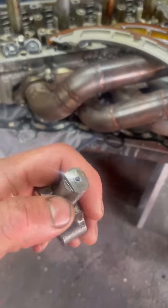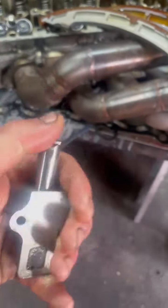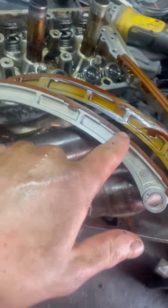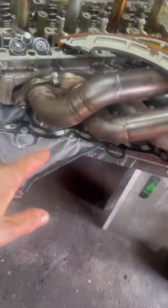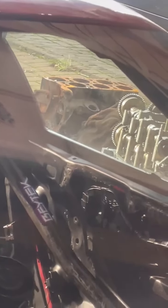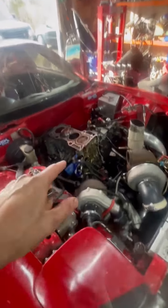So damage report is this piece here - my tensioner. As you can see, the chain's actually been running on the side of the tensioner, just here. You can see it been wearing away. So the chain itself - I'll obviously stick another chain on it, but the chain doesn't look too bad. You can see what's been wearing on the tips there. We'll stick another one on. It's also run off the side of the tensioner. I have no idea how long this has been doing this for - this could have been on the dyno, it could have been any time. But this is what it's supposed to look like, and that's what's worn down. And the head gasket. So we're pretty good to go, guys. I'm happy with that. It's not time for VR6 yet. But as you can see, there's a spare block down there for mock-up that is kind of staring at me. After this weekend, we're going to stay K-series at least for a couple more months, I think.